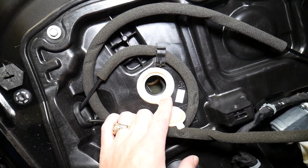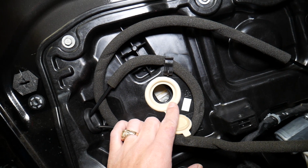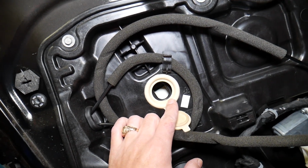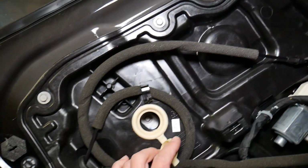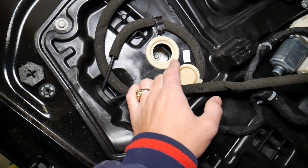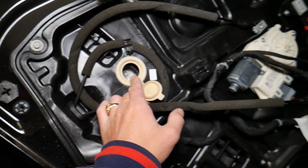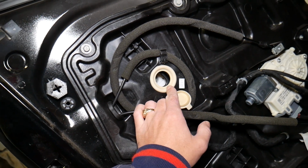Now, we'll bring the window down. Up, too much. A little bit more. Okay, let's see. This one will work. This one will work too. You can see we have 2 bolts here that we need to remove now. Those are 8 millimeter, guys, 8 millimeter socket. We'll get them loose and we should be able to pull the window up.